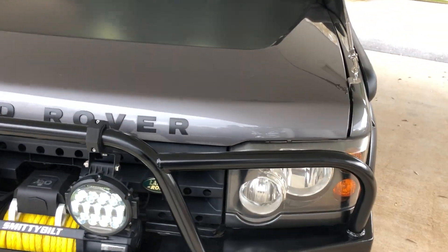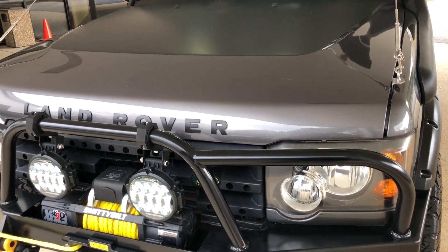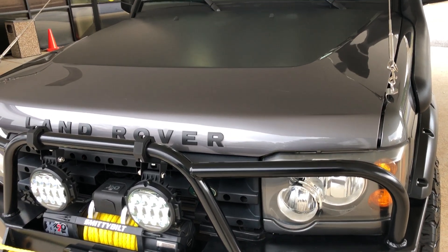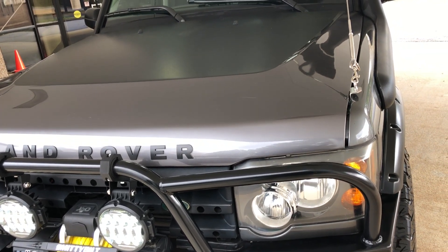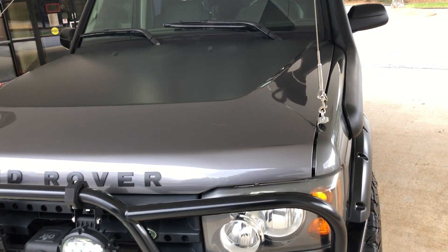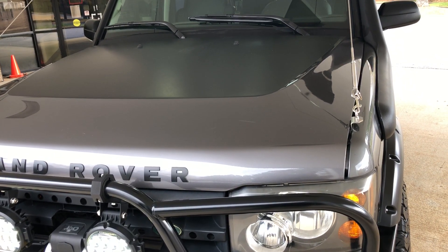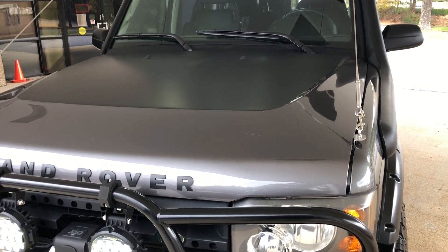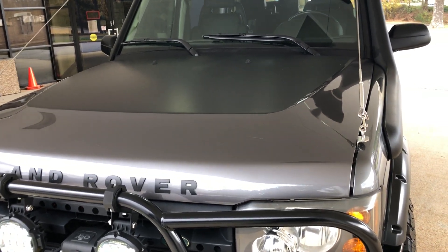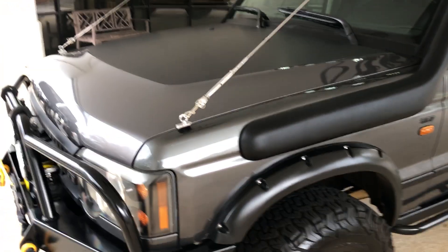I may do another little video on the engine. It's a fully remanufactured engine — the block has been stripped down, pressure tested, blueprinted on a CNC machine, Turner Engineering, top hat liners installed. All major internal wear components have been replaced: cam lifters, the whole enchilada. ARP head studs, remanufactured heads — everything on the engine is done. All the ancillaries: coils, wires, plugs, hoses, water pump, catch tank — all new underneath. We did the thousand-mile test drive just to make sure that all that work has come out well.